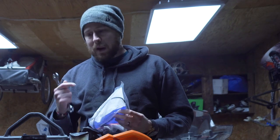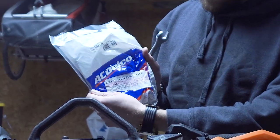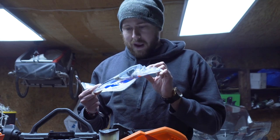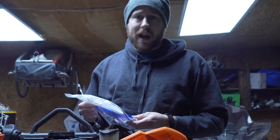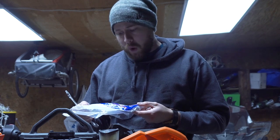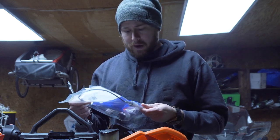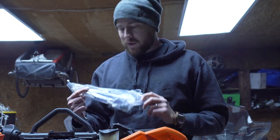The part we're dealing with is from General Motors — you can see here it says AC Delco rather than Arctic Cat. This part costs about $100 taxes included, and the specs are virtually identical to the Arctic Cat one, just substantially cheaper. The GM part number is GM 126 432 46 — write that down if you don't want to buy a $260 Arctic Cat sensor. If you live in the States you could probably get this for like 50-60 bucks American; we just get hosed in Canada.